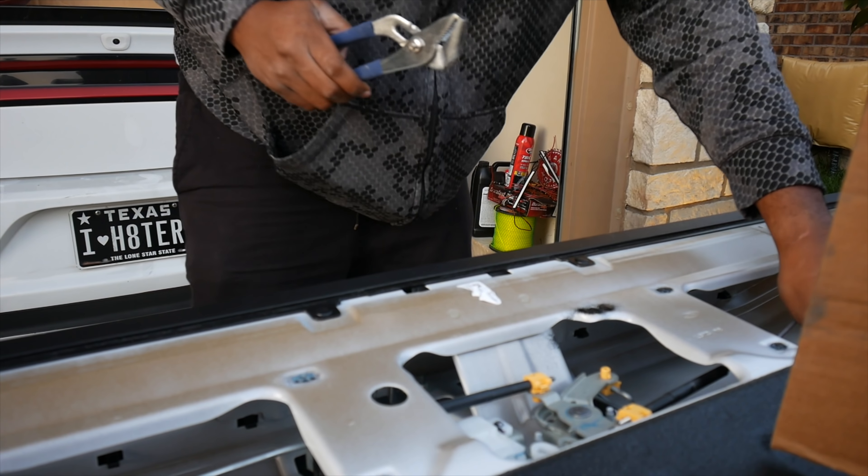So this is the grill right here. You have to take your grill off, of course, and there's three little bolts you just use to take it off, and that is that simple. But the rear one is the hardest one. Hopefully you enjoyed how to take off a 2018 and 2019 front and rear emblem. All you need, guys, is a T25 and a flathead screwdriver, or some type of tool to take it off.